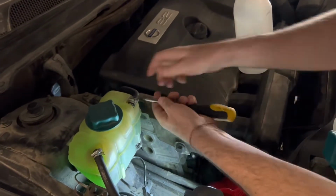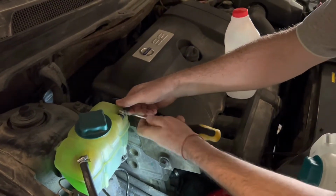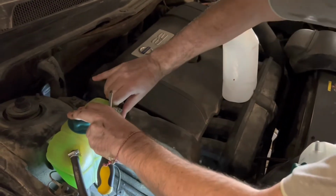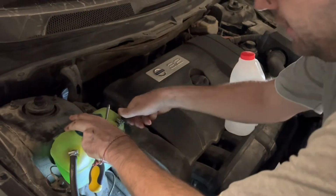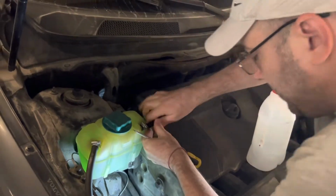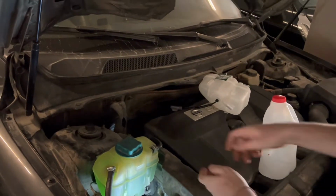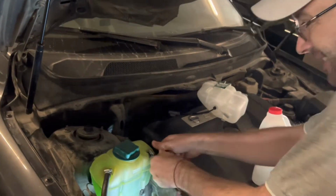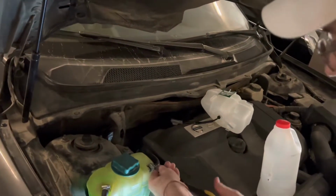If your car has the original one, it most likely is not gonna have this screw, so you have to cut it with pliers, and then you have to buy from a hardware store similar type of bracket to replace it, because the original ones are one-time use. I bought this one on Amazon. I'll post a link in the description. This actually requires more tightening than I thought.